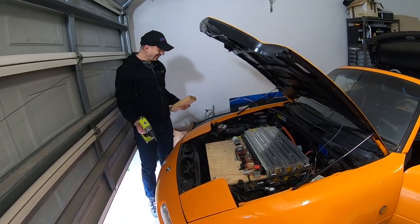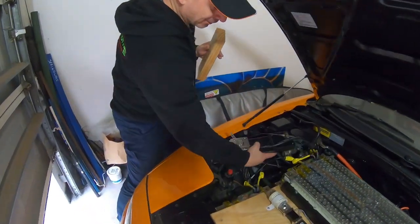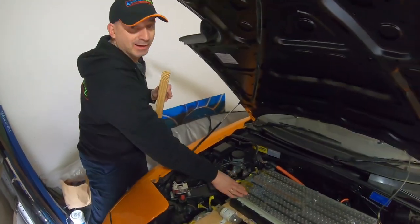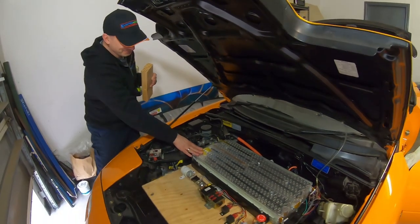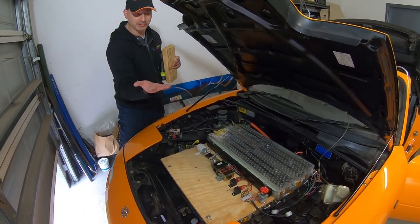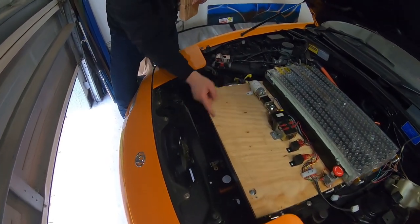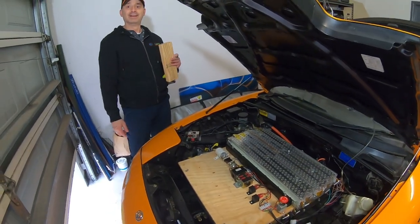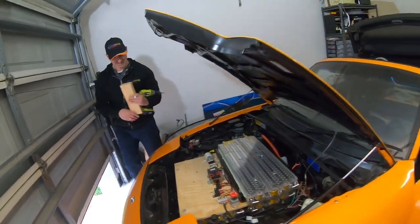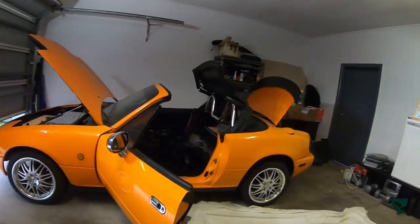So what are you doing? I've just taken out the accelerator. Reconnected it all up. I've unplugged the two Tesla modules. And now I'm going to unscrew them. That way we'll be able to lift this Tesla module off, then lift this whole panel off, and then get this one out. Then we'll be able to get to the motor and the motor controller. How does that sound? It's pretty easy, actually. Pretty quick. It's not like pulling a whole motor or an engine out of a car.